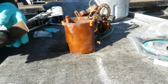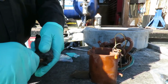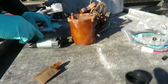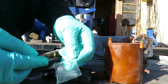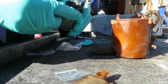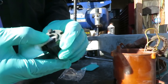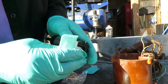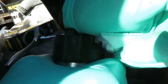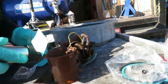The customer came back and she got both strainers — that is great. Let's get our new one and set it on here. Notice that little snap ring right there — this one goes on just like this, and make sure it's pushed on tight. Try to look in there and make sure it's flush with the pump. Now we're going to bring our assembly — the top cover — back over. Inside, that ring is going to go over this part of the fuel pump. We're going to bring it down and make sure it's on top of that.